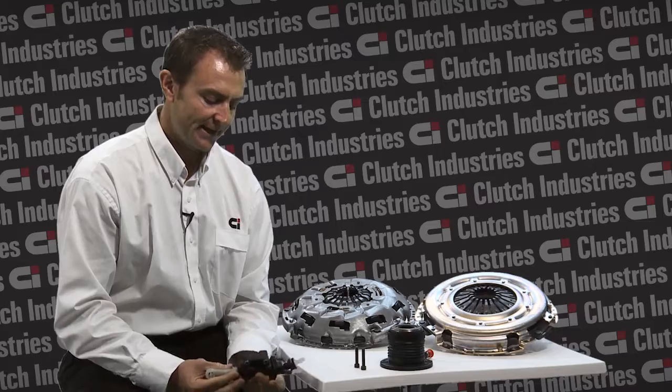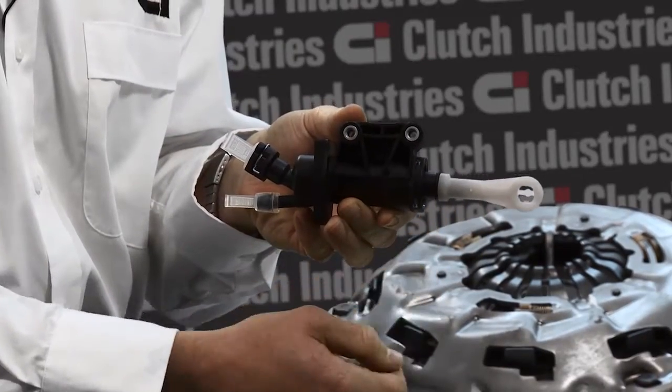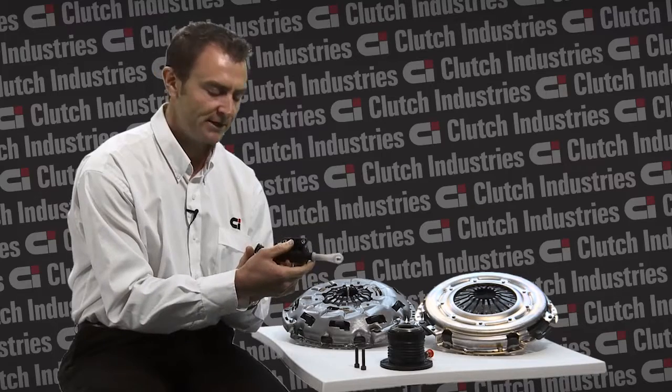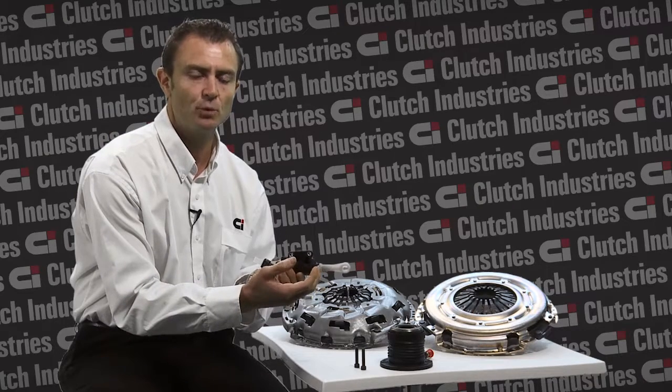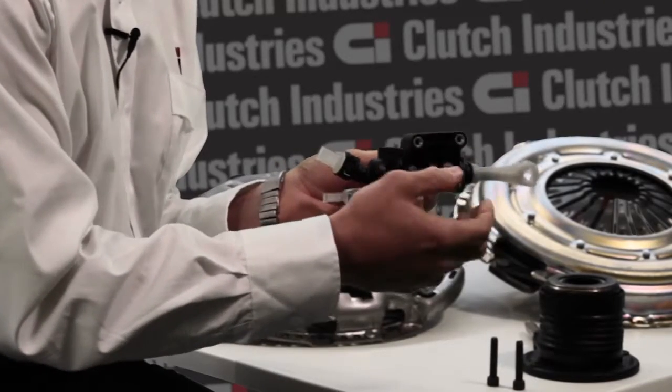In this case, your vehicle may have a master cylinder with a push rod that is adjustable by a thread. Now, previously, this push rod may have been adjusted to compensate for clutch wear. If you find this is the case, readjustment of this push rod needs to occur again in order to get an acceptable pedal height.